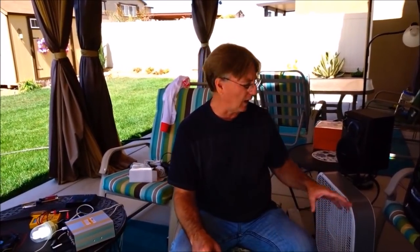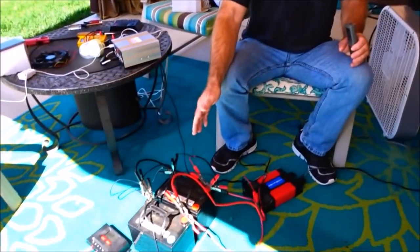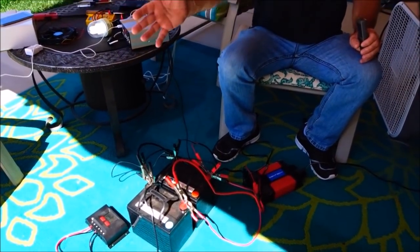You'd use a 12-volt stereo in your RV rather than convert this much power — we actually have a big copyright violation issue playing music in the background. We do have a decent 36-inch TV in our van that only uses about 30 to 40 watts of power, so you'll have to watch what you purchase or use. Right now with that on, we're using about 180 watts, and my system has just 420 watts during the night. So in just two to two-and-a-half hours of time, you'll kill your batteries using this much power.